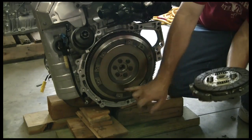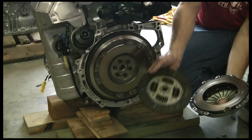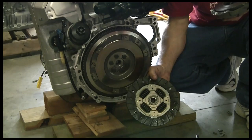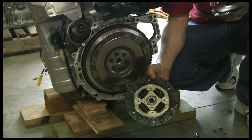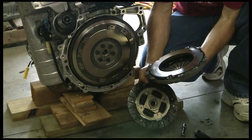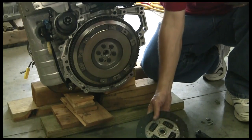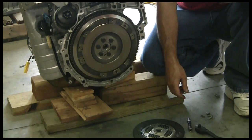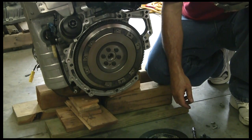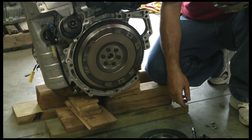So like we talked about, our flywheel here will have to be unbolted. There's our clutch disc — that's going to be mounted on that spline directly mated to the transmission. Our pressure plate is going to be remounted up to the flywheel, but all of this is going to be mounted to an adapter that we're going to have to make for that electric motor. Keep in mind all the critical measurements we're going to have to make, because this all needs to be in relatively the same place.